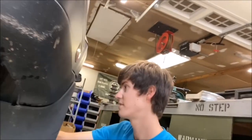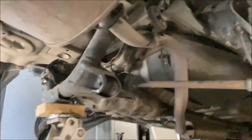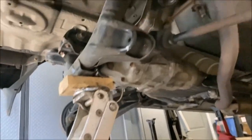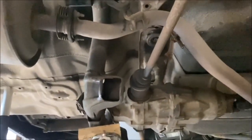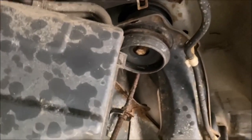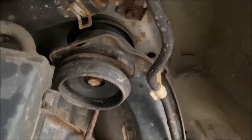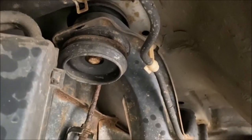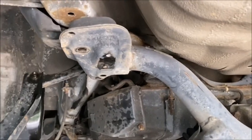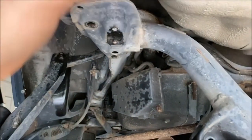First thing we're going to do is take the subframe out. We have the jack under it right now — you'll need to take the jack out from under the subframe to do this, but I'm leaving it there so I can get all the bolts out and the subframe stays in place. What's cool about these is the diff bracket has bolts that are gigantically too long — they go way up in the body, so you can put the spacers in and reuse those bolts without getting longer ones. I'd suggest putting one of the new bolts from the kit in before releasing anything so it doesn't get out of alignment.